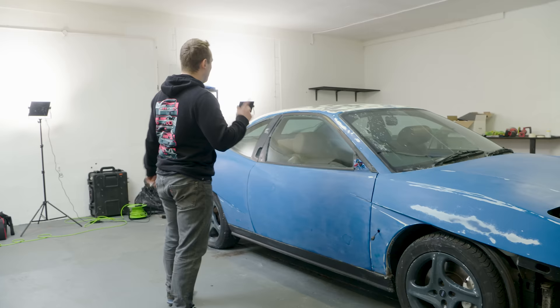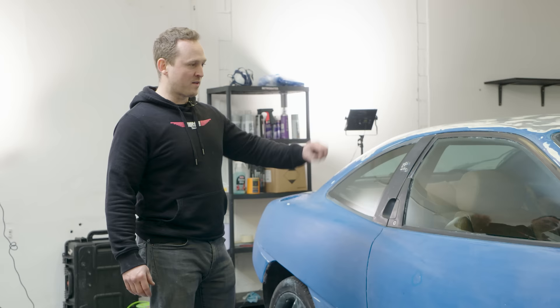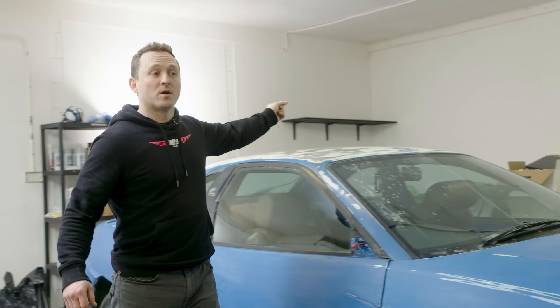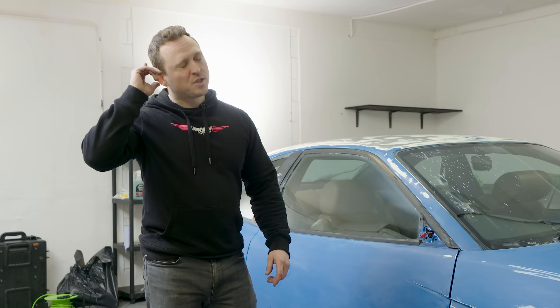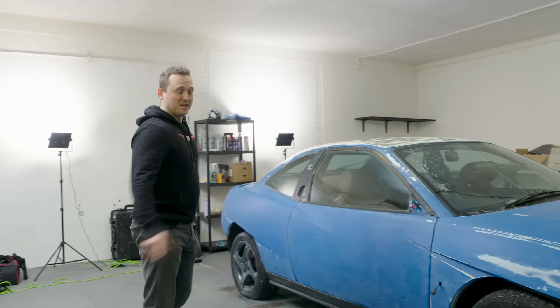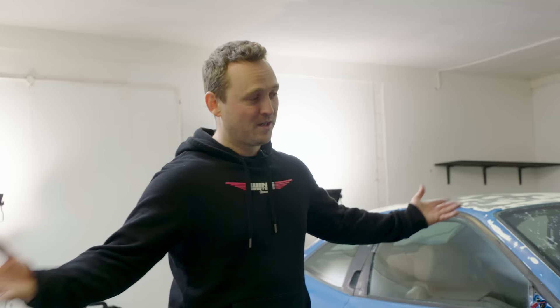What we need to do — because he looks like a right state — is wet sand the entire body to 800 grit sandpaper. Then we need to do some filler work on the rear wheel arch because it's quite lumpy. Then degrease it and mask it. Then two, maybe three layers of primer. I think genuinely this is going to come out a lot better than any of us are expecting. I'm expecting a high gloss finish, and if there are runs, all we need to do is flat and polish it. We're also going to be using Barney Saunders from Saunders Detailing. This is going to be a transformation. 350 quid — if we can get a good result, we've saved ourselves ten times that. Let's crack on.